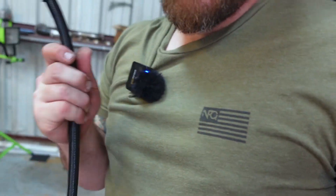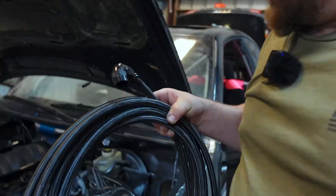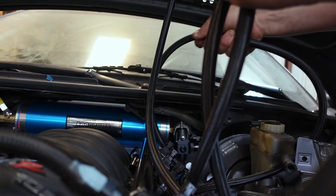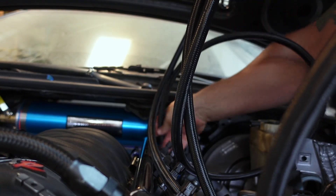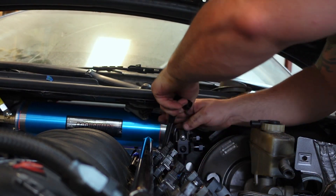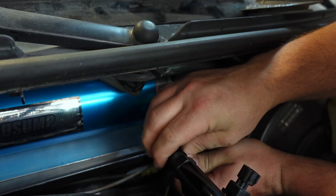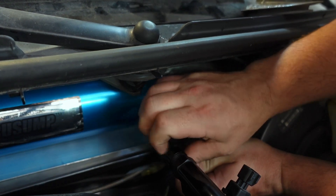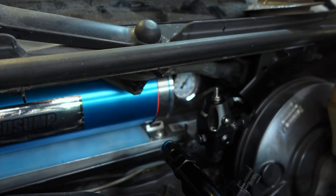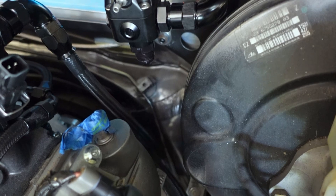So now I have the first fitting done. It's a pain, but it's done. I'm gonna thread this onto the fuel rail and tuck all this line down into the car. It's PTFE and it's really hard to work with — you put one twist in and it's like, nah, we don't want to do that. This is my feed line; I can just bunch the feed line and return line both together going down and out.